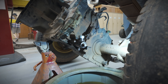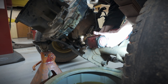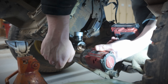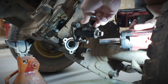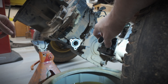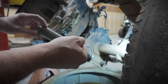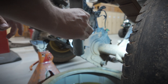Next we're going to take out the strainer - three bolts that hold it in, 12 millimeter head, 8 millimeter bolt. We can see them here. Got some metal there, and we'll see what we find on the inside.